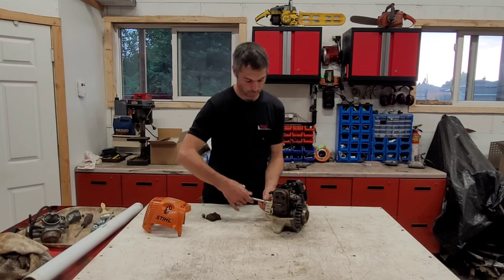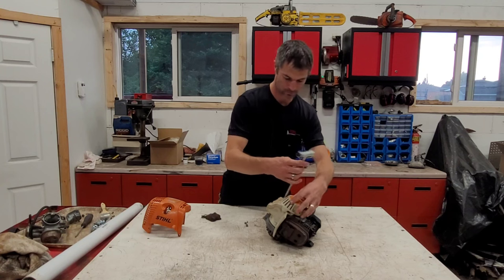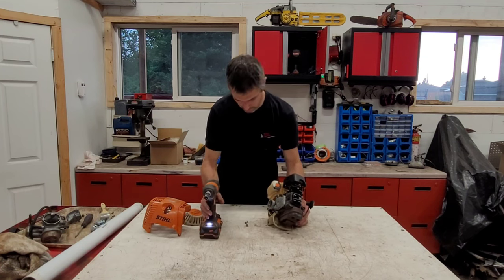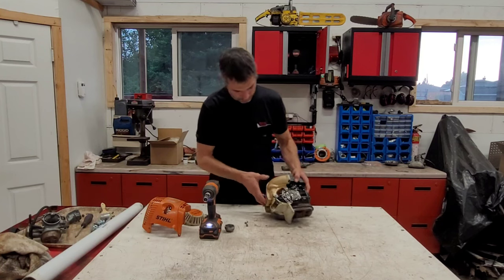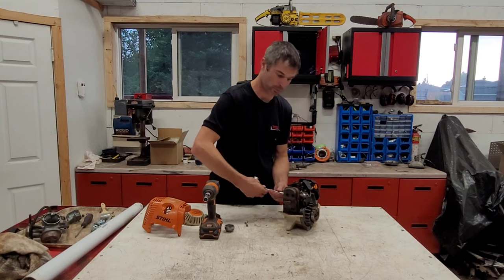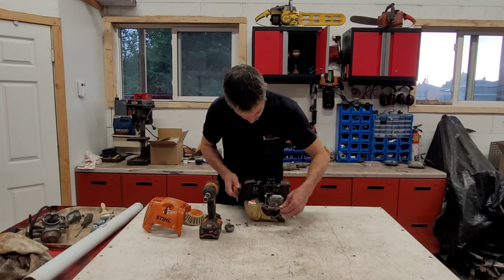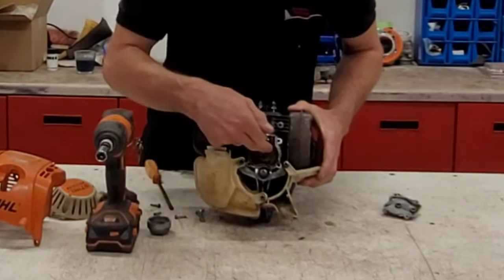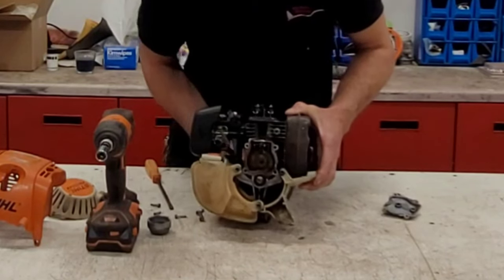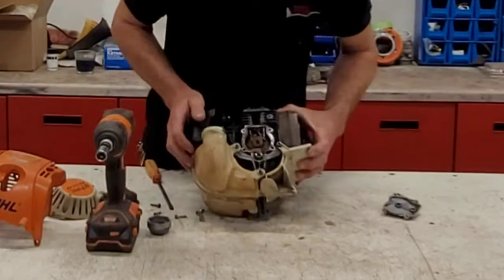Let's pull the plug to make it easier to rotate, and I want to get into what this thing is really about. I'll pull the manual recoil as well to expose that cam gear. We remove the starter ring, then remove the cam cover to expose the technology inside. Here you can see the cam gear down below with your followers, and as it rotates your valves are doing their thing.